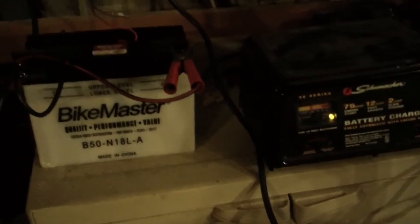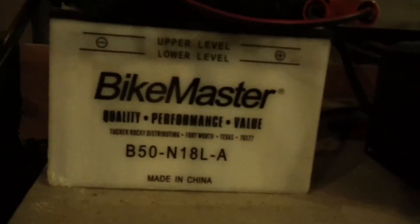Not a maintenance-free battery, so I got it on the charger. Got about 2 amp on it, trying to charge it up, but I don't know if it will or not. I checked my fluid level and it doesn't look high enough, so I'm going to have to go get some distilled water and get it in there and see if I can get a charge on this battery. It doesn't look too old, but I don't know.